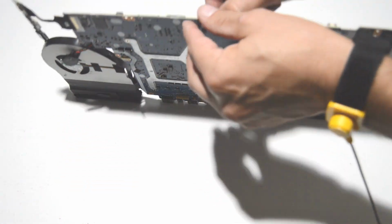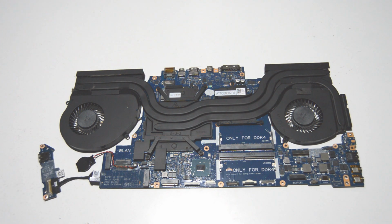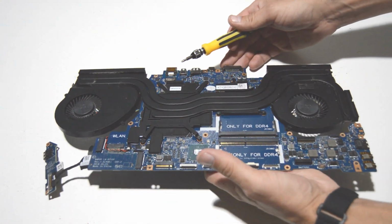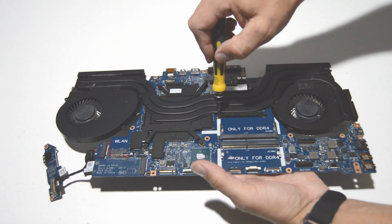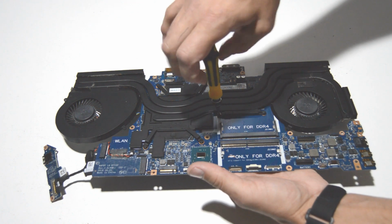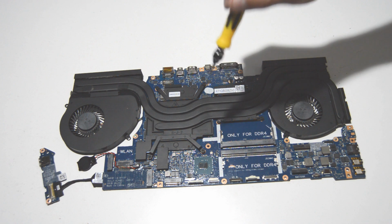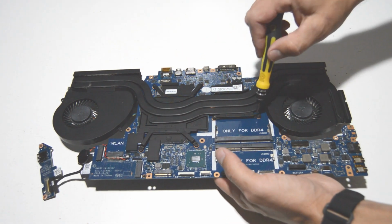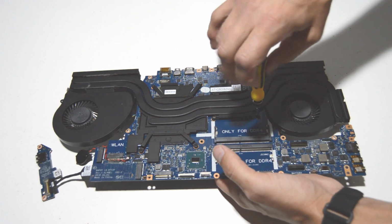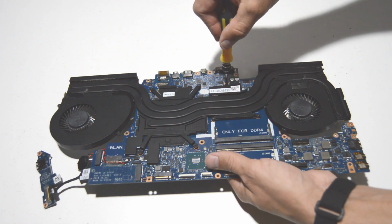And the tape. Then we can just flip her over. Finish removing the screws from the heatsink. Now this type is better to kind of support the bottom with your hand, because sometimes these screws, especially if you have to press down hard into them, you can start bending the motherboard. That's not a good idea. So as long as you've grounded yourself or you've touched the ground, it's okay to handle the bottom and like the other parts of the motherboard.